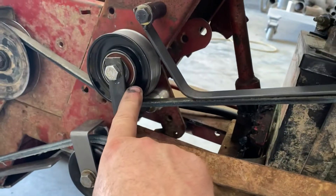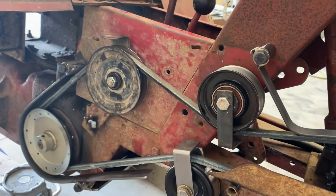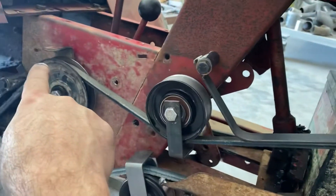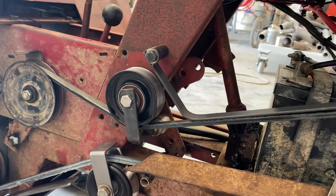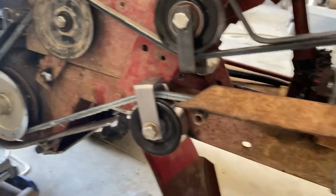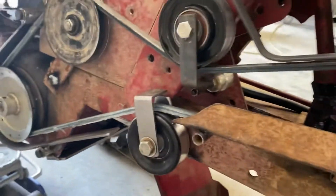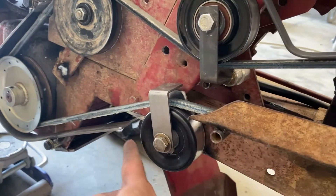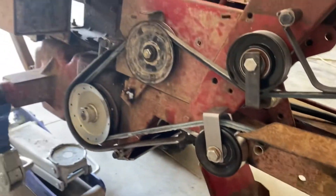On this setup, running an upper idler. That just seemed to make the clutch a little bit easier to release, a little more predictable, much smoother. Instead of going all the way from here to the engine pulley and having to work that much belt with all the flop in it, that tensioner really helped. Then I went to Creepy Crawler's other half and went to the lower idler. The lower idler is providing more belt wrap and also getting that belt up and out of the way so you don't have a belt running all the way down below your frame getting hit by any debris.